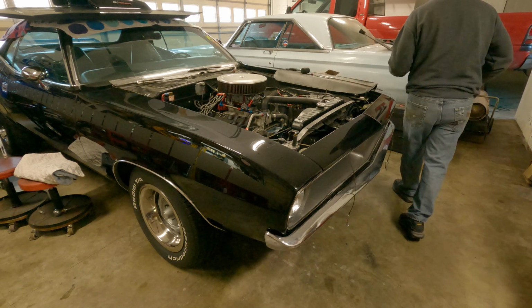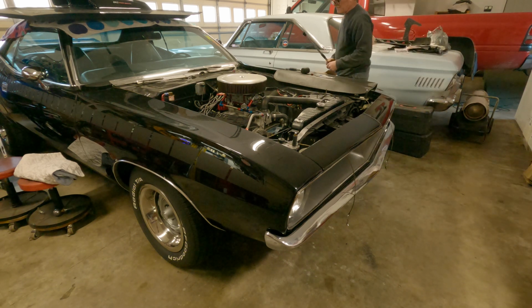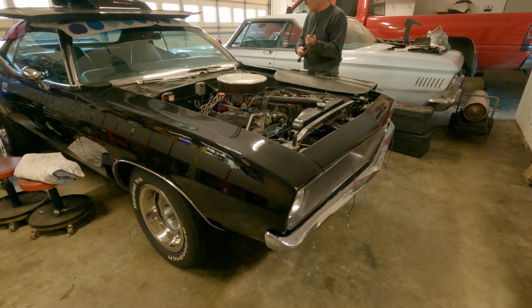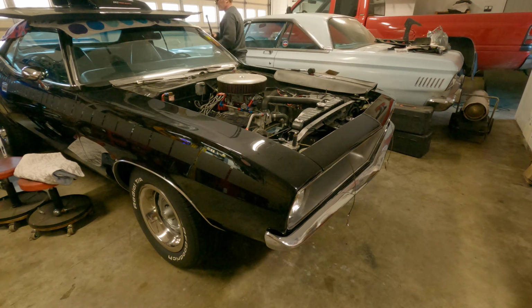Like if you pushed the brake on, she'd stop like that. Well, I never did that. And as you know, stuff doesn't fix itself. It's kind of what you'd hope for, but the brakes have kind of sucked. So I'm going to push the brake down, jack up the front end, and see. I was thinking maybe that right front wheel was locking up. So, I don't know. We're troubleshooting. So I'm going to set the brakes, push this against the seat, and see what happens.